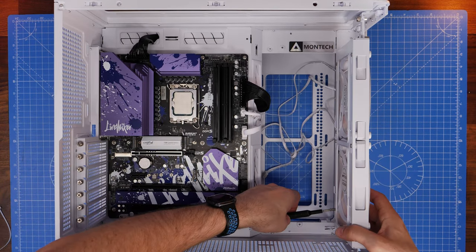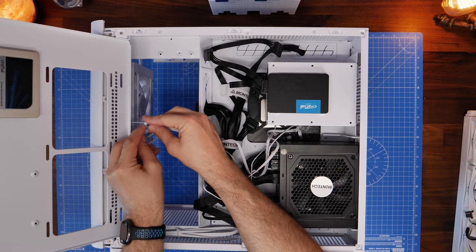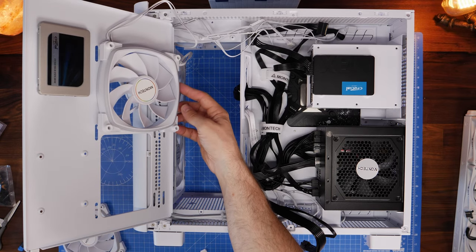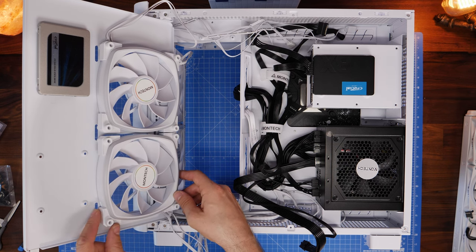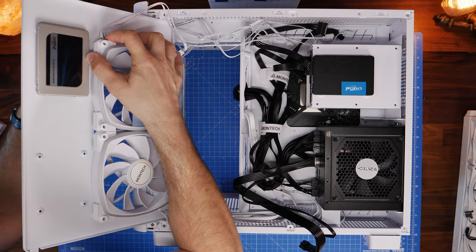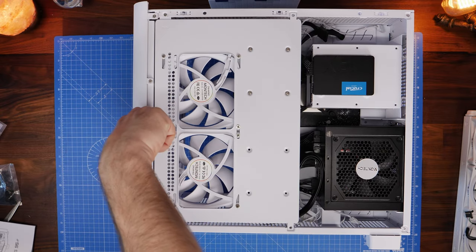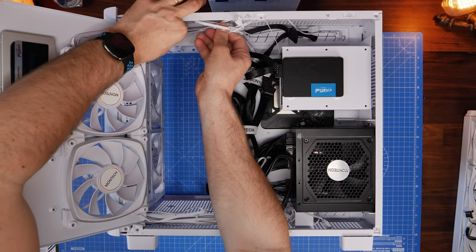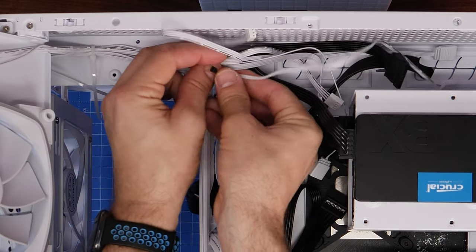For fan mounting, you can mount fans to the side tray in place, or move it to the front. To use the airflow bracket: unscrew the thumbscrews, pull the bracket out — it's on a hinge, so pull it out then lift it up and tug it through. There's a bracket at the top you unscrew slightly and adjust downwards, and another at the bottom — reuse the thumbscrews to re-secure onto those two mounting points. Mount two fans with blades facing outwards to pull cold air in from the front, running the cables through the holes in the tray to the rear, secured with the fan screws.